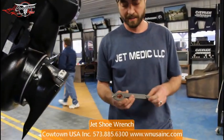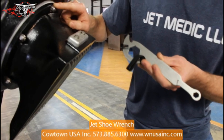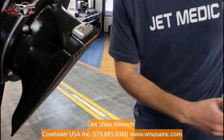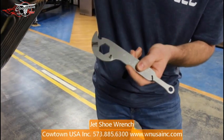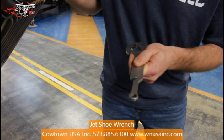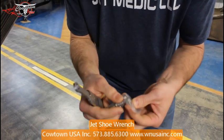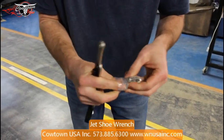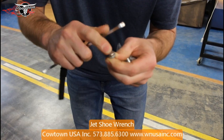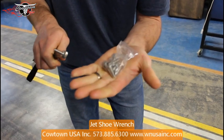Just an additional note here. This pump is made so that if you have a half-inch nut or bolt holding your shoe on, this is going to correspond with your shaft nut. For those guys that run a little bit smaller jet, this is our medium wrench. If you have a 7/16ths shoe bolt, this is going to be the shaft nut that will work for you. But in order to get around the clearance issues with the casting on the intake shoe, we'll give you a packet of eight stainless steel bolts. They've got a smooth flange and are made so they fit right in here — a 3/8ths head with a flange — so you can replace your factory bolts with these. And you've got two extra in there in case you drop one in the water.